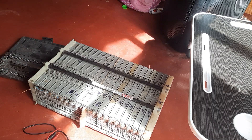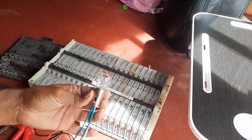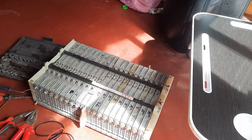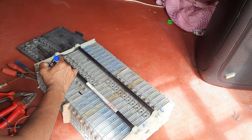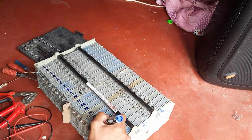So let's get on with the battery testing. For my battery tester I am using a multimeter to measure the voltage across the battery while I drain the battery with a load. For the load I am using a 3-amp headlight lamp. So let's see how the battery testing is done. Let's first number them up.